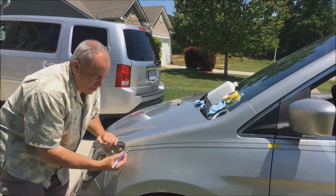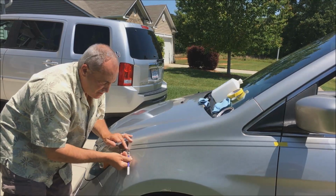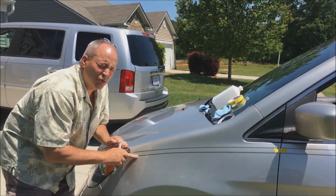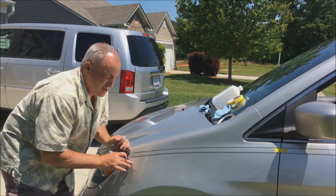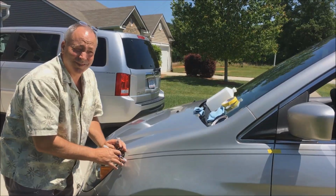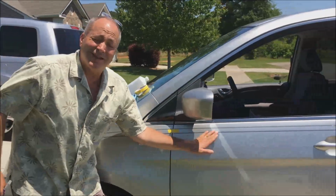One thing I like to do also is just bring the bottom line over the top line halfway. So I'm leaving some of the top color showing because it looks pretty, and because the bottom stripe actually gets to bite onto at least 50% of the paint. It's on paint. The other 50% of it's up on another vinyl stripe, although this vinyl stripe sticks to itself very well.